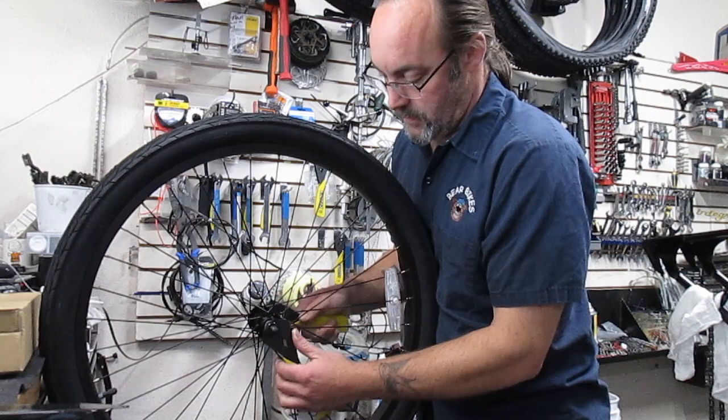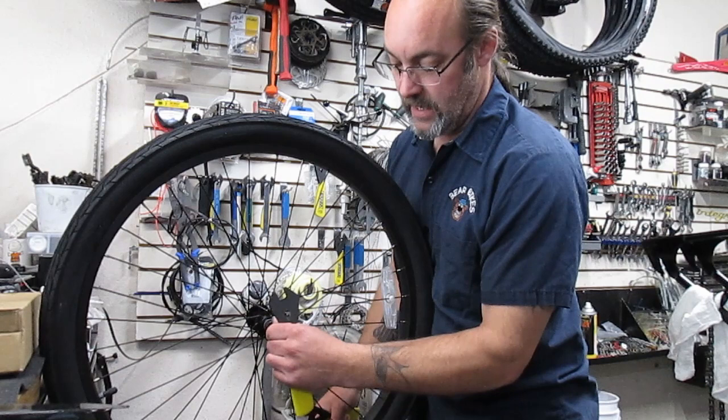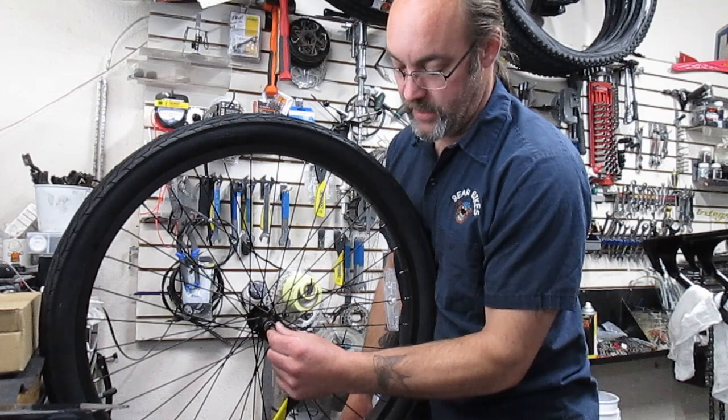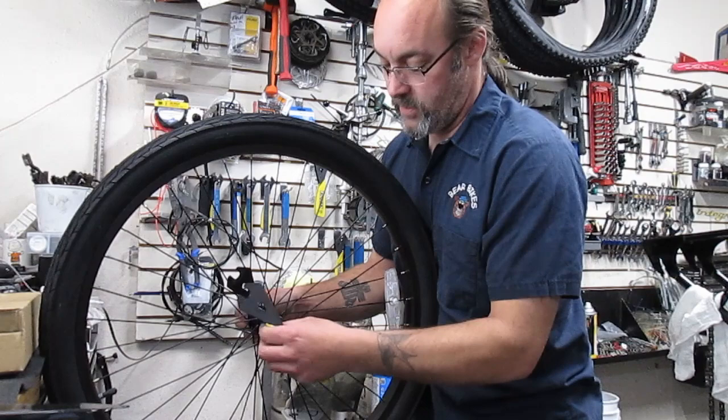And I wish you guys could feel what that feels like. Oh yeah, see, that's way smoother. Look at, I'm barely even taking the axle now and turning that. Beforehand, I had to take this nut and I had to turn really, really hard, but look at that. It's super easy to turn now. I'm gonna go ahead and loosen that just a hair more because I can still feel a little bit of grinding on the bearings. Oh, that's so much smoother. You can even hear it. It's actually way, way smoother.